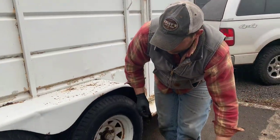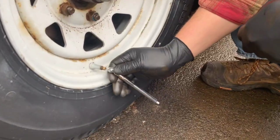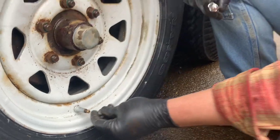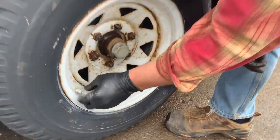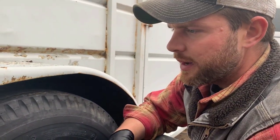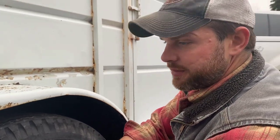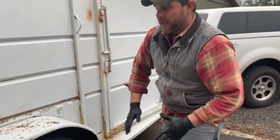Going pretty smooth, really. The other side was 40 PSI. Let's see what this one is — it's like 38. That's pretty close to 40. That one's 35 — so it would probably be a good idea to add some air to that one. The bummer part about working outside is my air compressor is inside. I don't think my hose is long enough to reach out here. I will get those filled up — maybe I'll use my portable one. I'll figure that out.